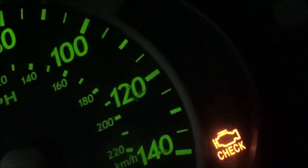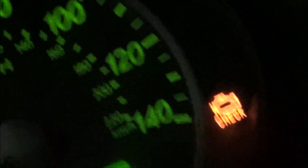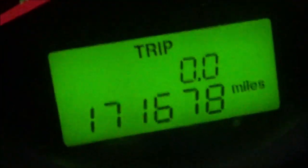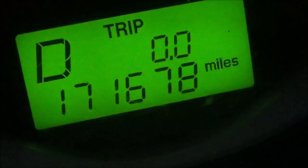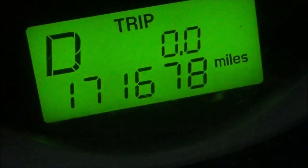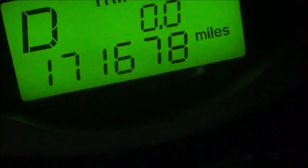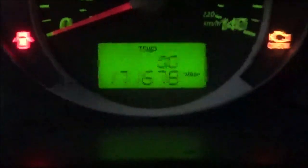Got it — now I'm going to turn the brakes off. See — Drive. I put the brake back on, Drive goes off. Turn the brake light off by taking my foot off the brake: it's in Drive and you see the Drive light come on. Put my foot back on the brake, the Drive light goes off. The computer thinks that I am still in reverse.